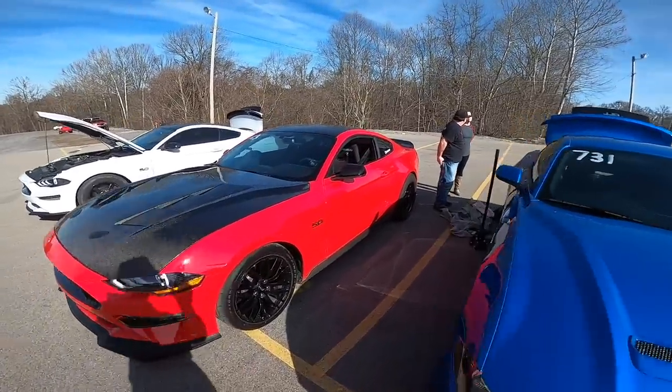Let's check the tire pressure real quick — trying to figure things out. So we dropped the tire pressure. We think we're a little too warm in the tires. We dropped that down and we're just playing with launch right now. Overall, very very happy — this is wastegate pressure making about 650 wheel. We might turn it up in this video, stay tuned. This is an absolute blast. I haven't been on the track in forever. Big shout out to Rob Shoemaker, Hellhorse Performance, all my sponsors, BMR Suspension — that's helping us get the 60-foot down. All of this is brand new suspension.